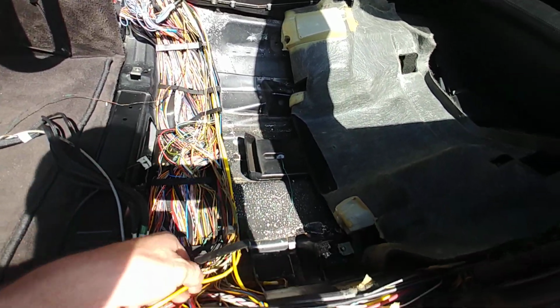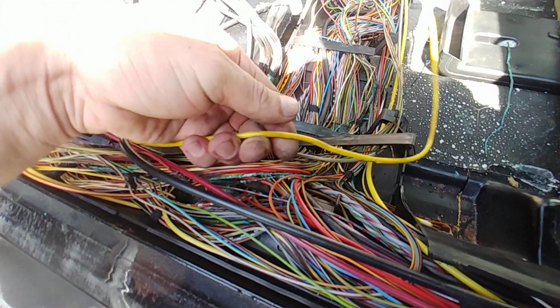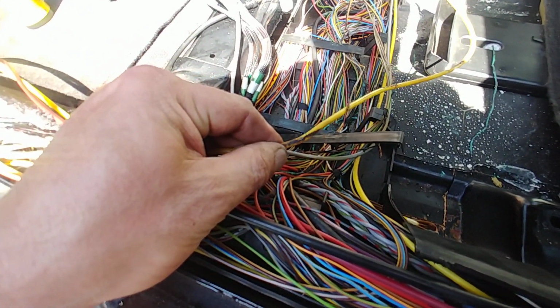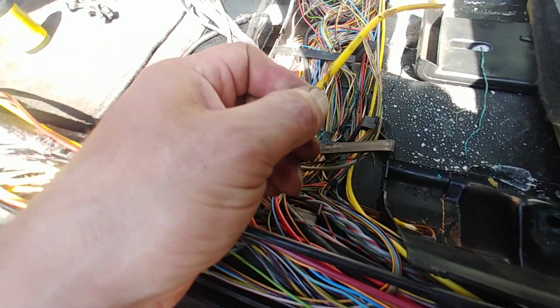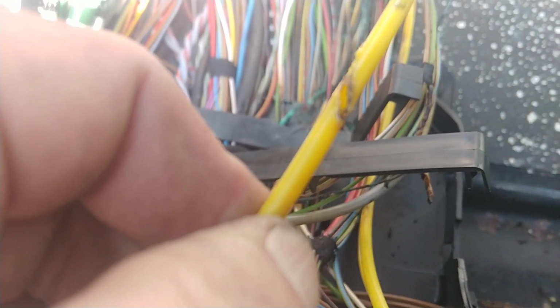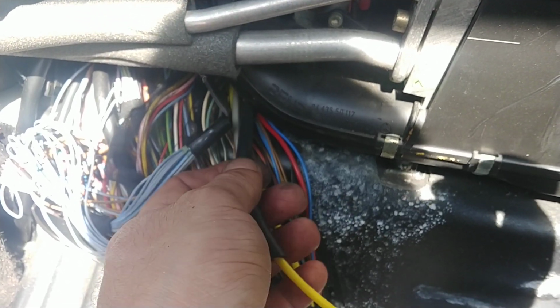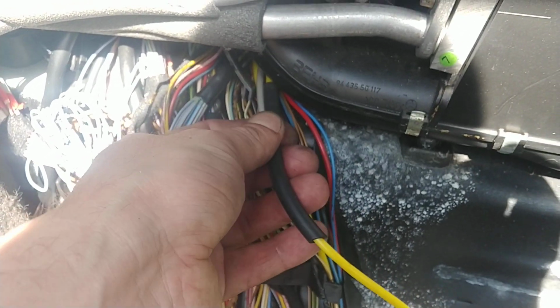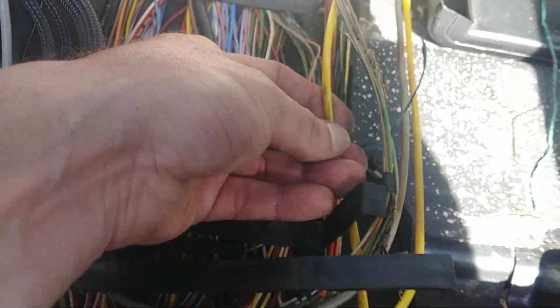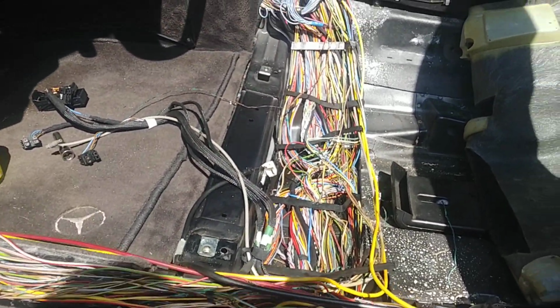And also, on top of all that, because the wires were heating up, it damaged the door locking system right here. This one is actually leaking pretty badly. Right here is a plain hole, actually. See where the wire basically melted through a hose right there. There was also damage here. That one I found relatively fast. Well, if you call it fast, but I guess I did it. I fixed this area, but then there are more. So I have to double check if there are any other possible damages to these pipes. Okay, basically that's about it.